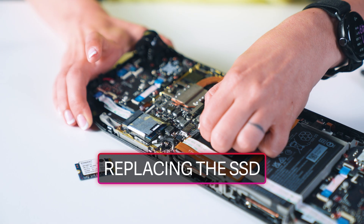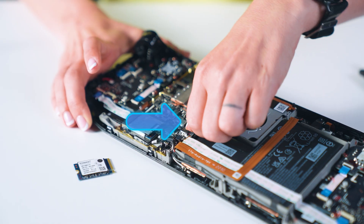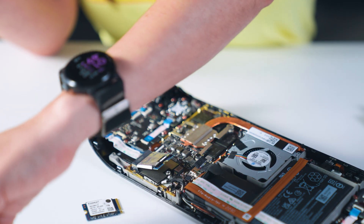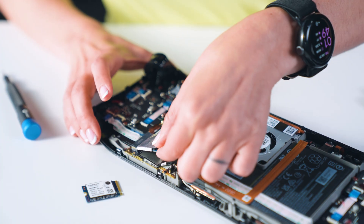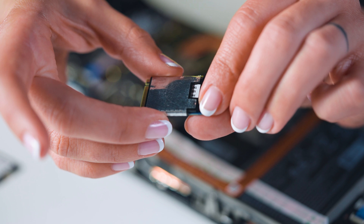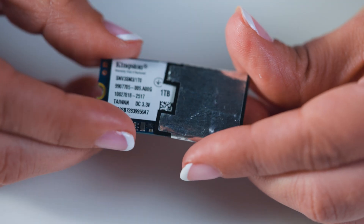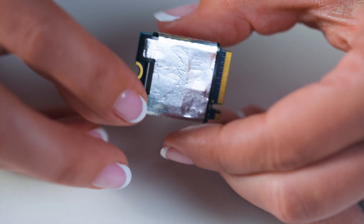With the motherboard exposed, disconnect the battery by sliding its cord by the pull tab and pulling directly away from the motherboard. Now you can remove the SSD screws securing the SSD. The SSD will pop up a little — grip it by its end and pull it out from its M.2 board connector to remove it. It has ESD shielding, which the replacement drive will also need. Slide it off carefully — you may want tweezers for this — and apply it to the replacement SSD. Make sure it's a snug fit or it won't install properly.